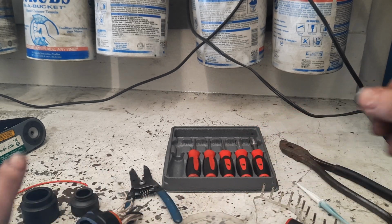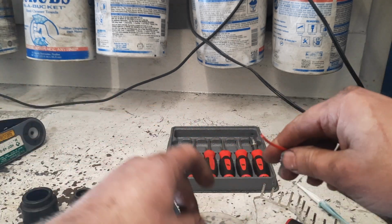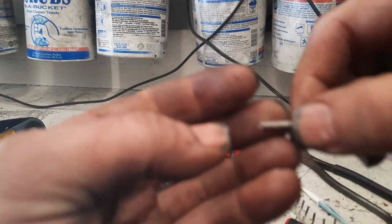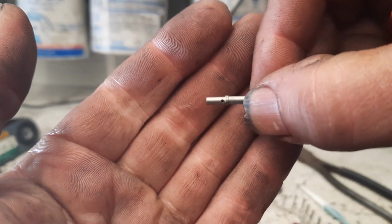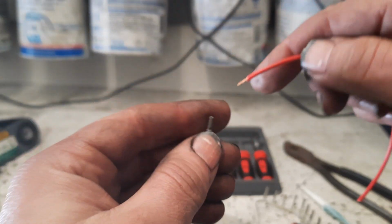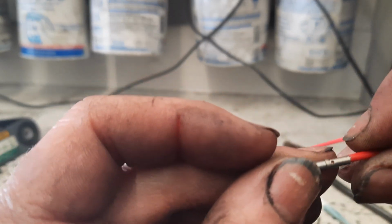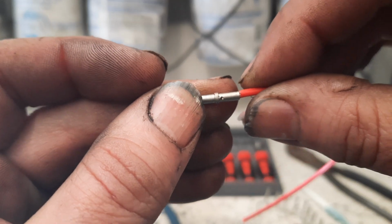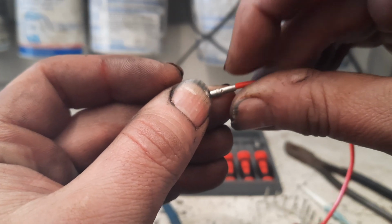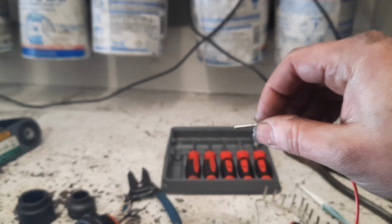But the next thing you would do, once you got the wire out that you're replacing, and I've already done here, I haven't checked it, but I stripped this wire back on the end here. And there's a, see if we can see that little hole there. There's one on each side. I guess I'm lying to you. There's just one. And you want to install this in there and just make sure that you can physically see that through that hole, which I can see. I think you guys can see that. And you want this to be as close to that body as possible, because that's why you need that inserter sometimes, is the wire might try to fold up on you. I don't run into that very often, but every now and again.